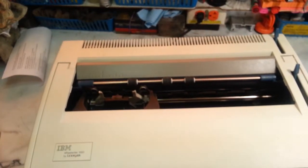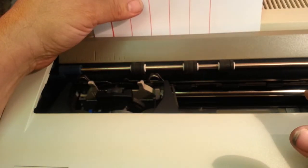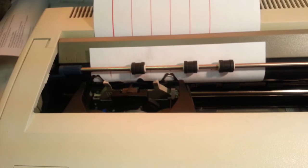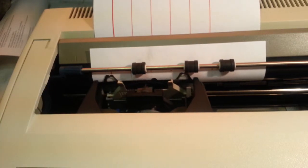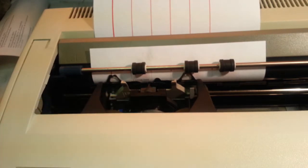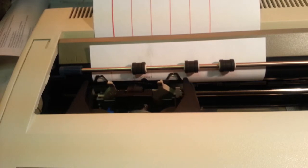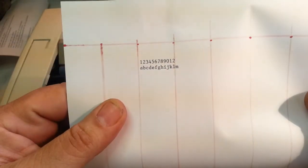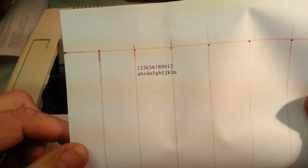It's all ready to go. Let's zoom down a little bit and we'll put a paper in here. This paper has one-inch columns so we can take a look to see what's happening. Let's move up to one of these one-inch columns right there and we're just going to type in — that's a 12-pitch wheel so it should be 12 spaces per inch. If you look down here, it's got 12 spaces per inch. That's what this typewriter is going to type like with that print wheel. It's the only spacing it's going to do — you can't change it.